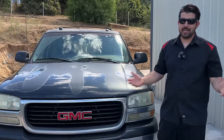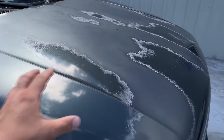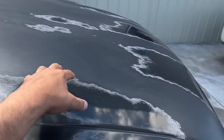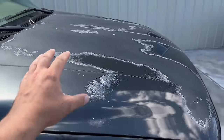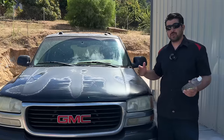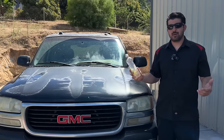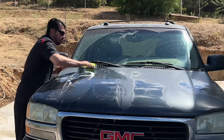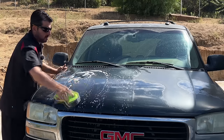Step number one that you can't skip in any paint job is to completely clean the panel that you're about to paint. I've already hosed down this panel, but when we're talking about cleaning a panel that you're about to spray automotive paint on, you need to completely clean that panel of grease, wax, and oils. Those are the things that will ruin a paint job. You can get some wax and grease remover and go over the panel with a microfiber towel, or if you don't have some, you can use dish soap — mix it with a clean bucket of water and completely wash down your panel. There is no perfect dilution ratio, but be generous.